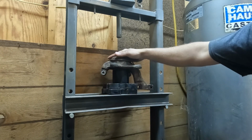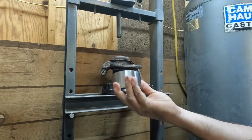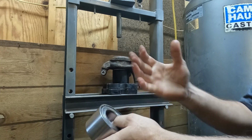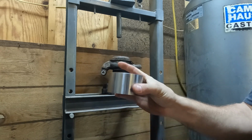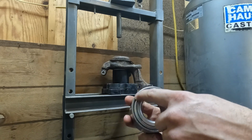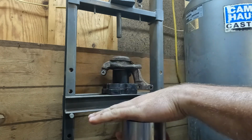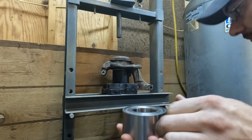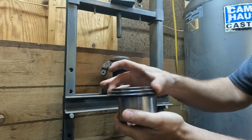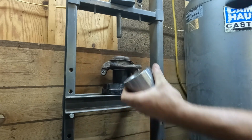So I've got this here supported. It's a little wobbly now, but the bottom of this is flat. And I've just made sure that it's supported all the way around. This is what the new wheel bearing looks like on the press-in style. The inside is 2 pieces. As you can tell, when I took the other one apart, half of it stayed. So now we're going to push the entire bearing into the knuckle first. The important thing to do is you can see we have the inner part, and there's this little cover, and then the outer part. Since the outer part of it is what's actually going to be getting pressed right now, when we push down on this, we have to only push on this outer section. So it is completely flush across there. I'm just going to be using a flat plate that pushes on everything until it's flush with that, and then I'll find something better just for that spot.